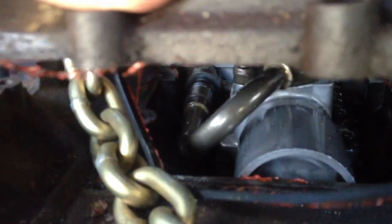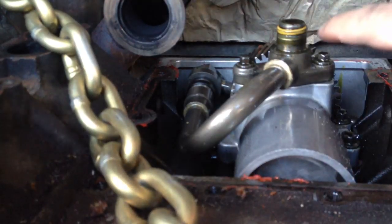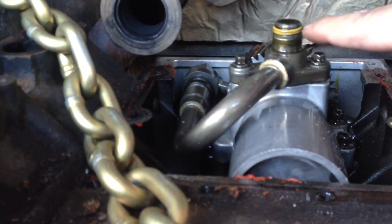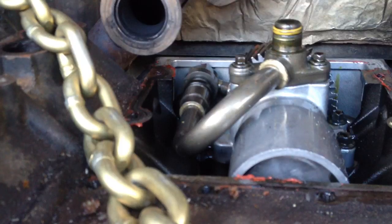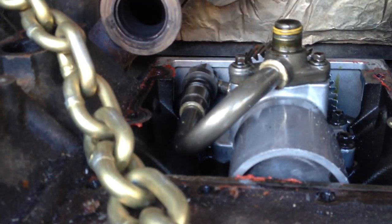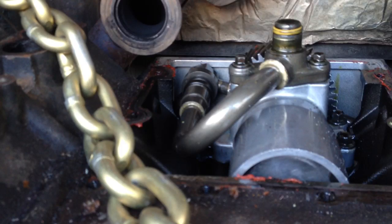Sometimes they say your high pressure oil pump is bad and needs to be replaced. If you're going to do it, you want to go inspect it first. On mine, they told me it was bad and wanted to charge me $800 for the part — total bill around $1,800. When I got it apart, all it was was that little yellow O-ring. It was completely shredded, blown off — half was in there and half was gone. I went ahead and replaced the whole pump, but if you're short on cash you can just have it tested. The issue was that injection control pressure was too low, and it would start when cold but as soon as it warmed up it would die — so I knew I was losing oil pressure.